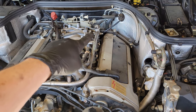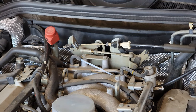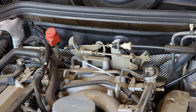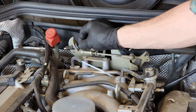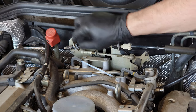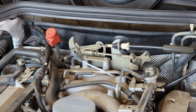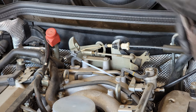The other fuel line connects right there behind where that one did. Next I'm going to remove the throttle cable from the mounting bracket on the engine — you just push it through, get the cable through that notch, then pinch this tab and it comes out this way.